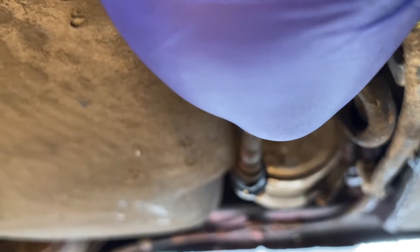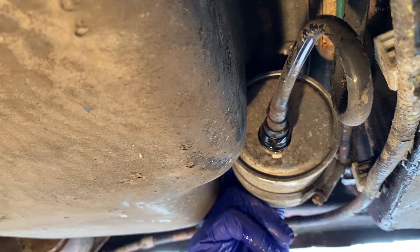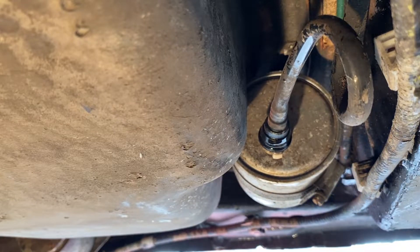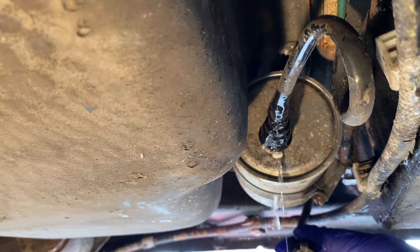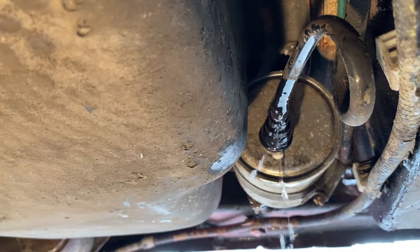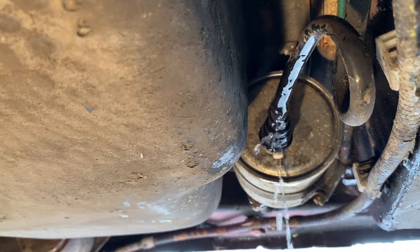There and it releases. So there's a bit of fuel coming out. Same on the other side. That's just coming out of the filter, don't worry about that. It'll evaporate off anyway so not a problem. If you're doing this on a tarmac drive outside your house, this fuel will eat the tarmac away. So get a catch can underneath.